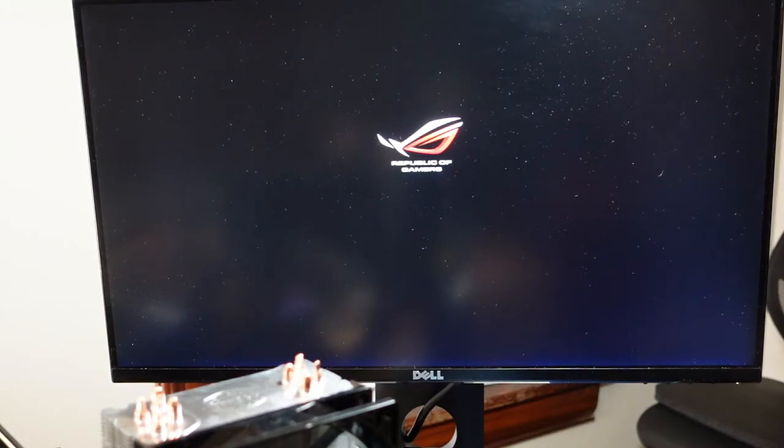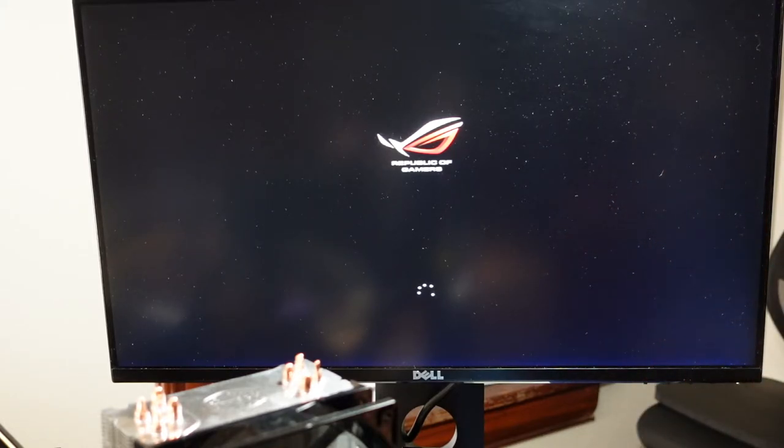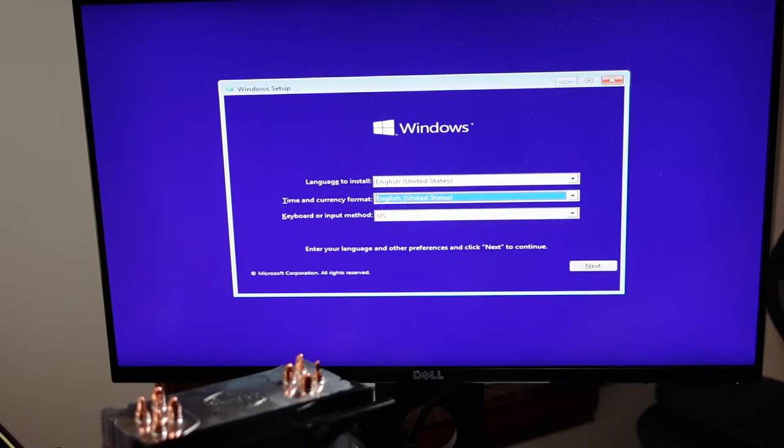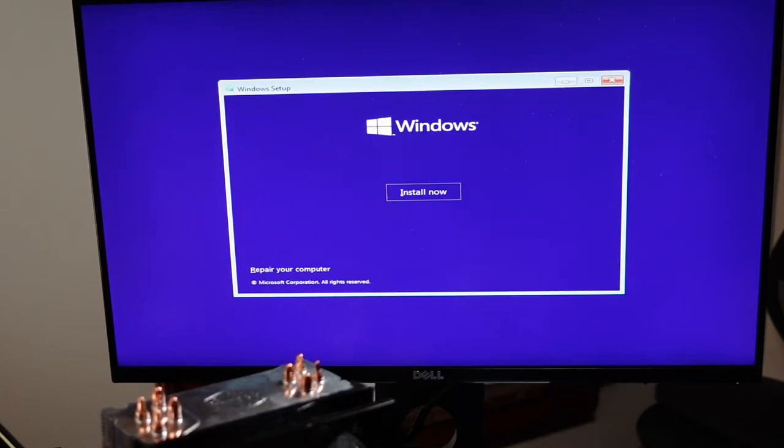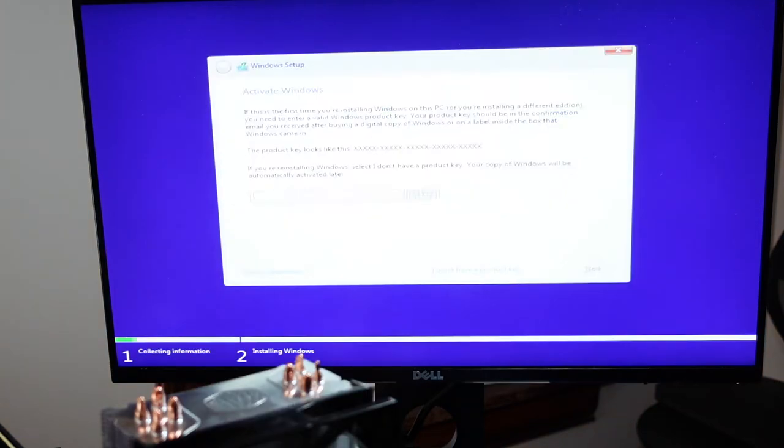So now when Windows searches for a drive, it'll see it as one drive. I just like it because with RAID 0, you double the drive size and get a performance boost. It's not usually double. It depends on how much you're writing too, but at least in the past, I don't know if it's still true, there's some caching and optimizations that happen with SATA drives and sometimes it's not available when you RAID the drive, so there is a possibility that it's not as fast. I'm not sure, but it doesn't really matter in this case. I'm more interested in just keeping it simple.